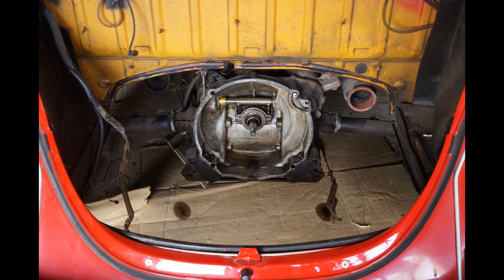Since I did not have enough space and light under the vehicle, I took pictures after the engine was out to show you where you need to disconnect the stuff. The yellow circles are the heater cables that need to be disconnected. The orange dots are where the heater pipe goes from the heater channels to the cab. The green circle is where the fuel needs to be disconnected and you need to crimp it off. The blue dot is where the throttle cable is coming through.